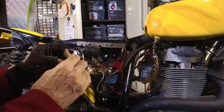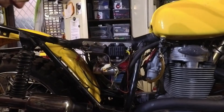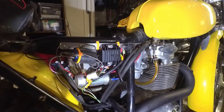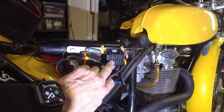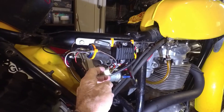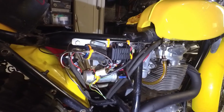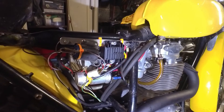I'm starting to get the electrics sorted out. I've decided to use a generic rectifier, Zener diode arrangement, and regulator. I've got that on now and it's plumbed in - I'm using the connector that came with it because it's got four spades in it, so I'll just put the old wires onto the spades for now, and secured it to the coil just to stop it flapping about. I've remade the earth strap and simplified it - there were about four earth connections, we've got it down to two.